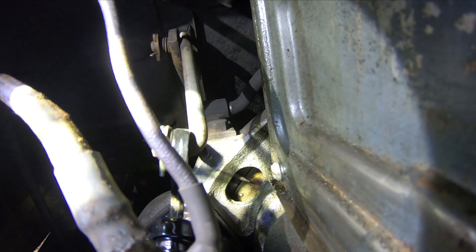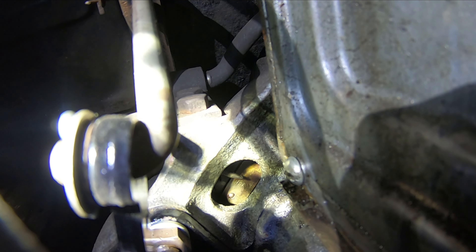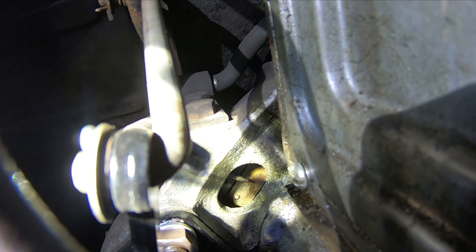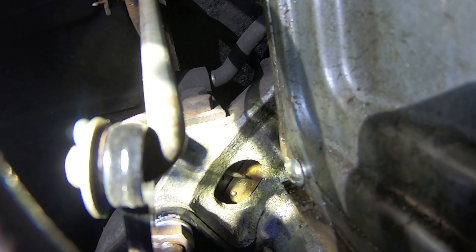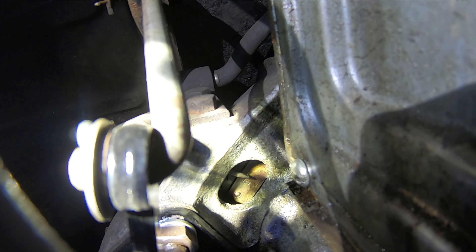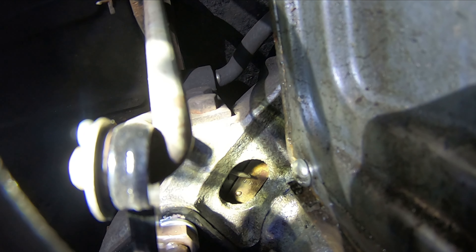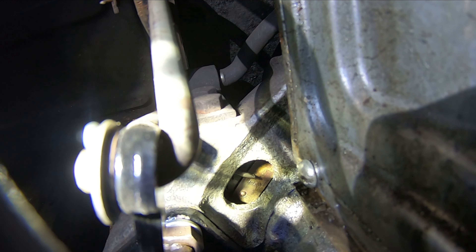So if you see that little hole down there, you can see that ball bearing in there — I'll try to get as close as I can. That little ball bearing is how we're going to set the timing. You have that needle setting there and you set the timing off of that needle with the ball bearing. So we'll paint the ball bearing with white paint and then we'll put a timing light on the engine and try to set this with the distributor cap.